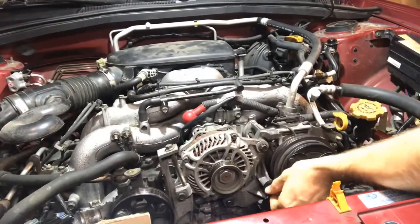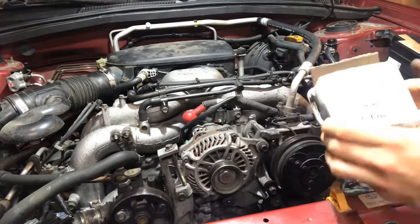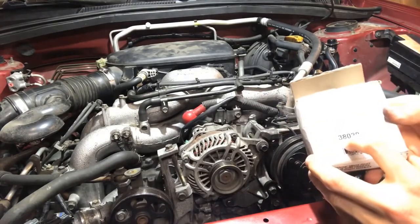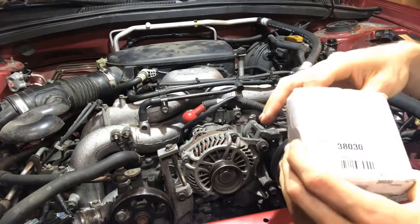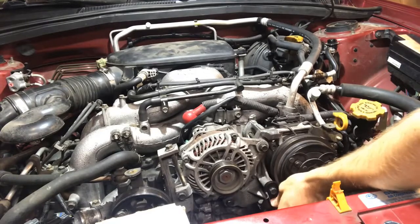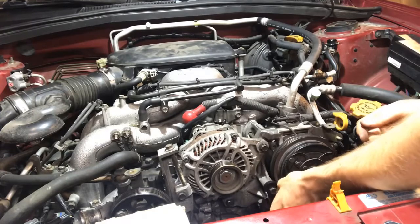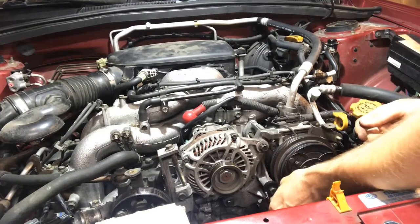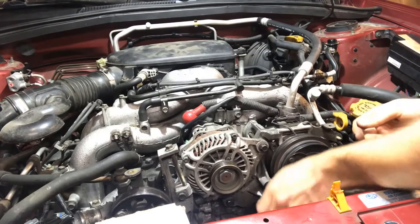I've already loosened it for the sake of this video so you can see what's going on. The replacement pulley, at least for this Subaru — a 2006 Forester — is a Gates 38030. This thing was about $29 on Amazon, very cheap, and it actually feels more reliable than the one that came out. Subaru used a somewhat plastic pulley, but the bearings are NSK so it's not super low quality.